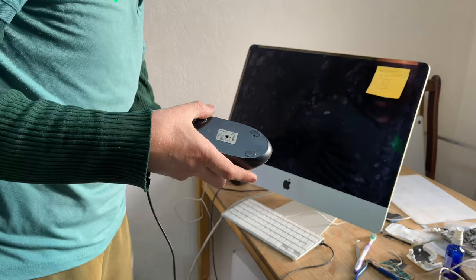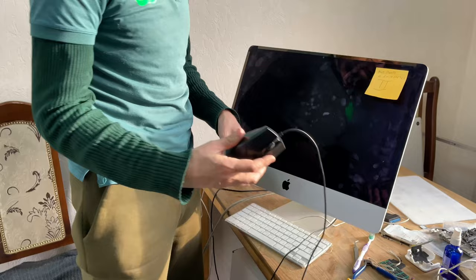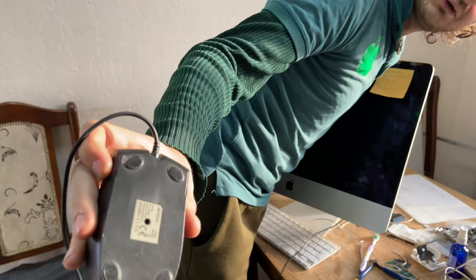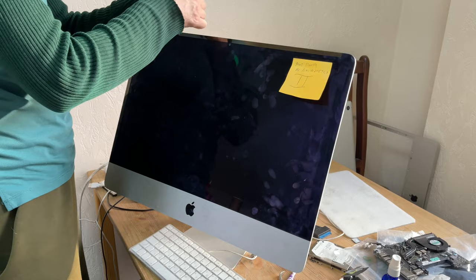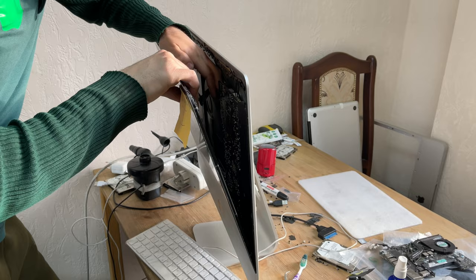Therefore, first of all, you need to remove the wireless module and turn on the iMac. Without it, the computer mouse can be used as an initialization tester. We see that the iMac turns on, the red light on the mouse lights up for 5 seconds and goes out. The display was in another service, but they could not determine what the problem is, so we are now